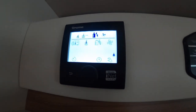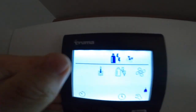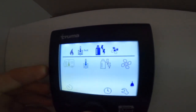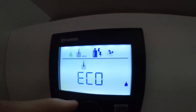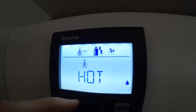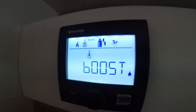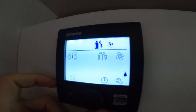You can set the temperature all the way up to 30 degrees or all the way down to off. Once happy, press enter to save. Moving further along, the water icon with the thermometer is how hot you want your water: off, eco at 40 degrees, hot at 60 degrees, or boost which prioritises the water by turning off the space heating.